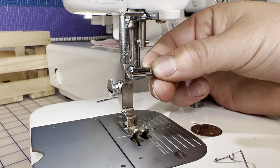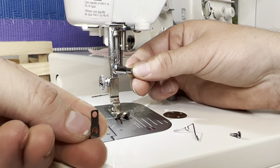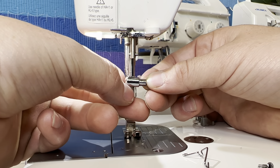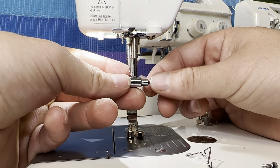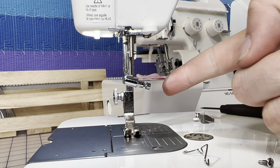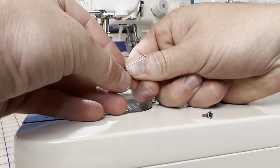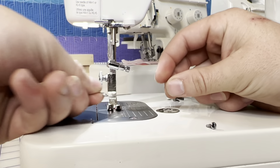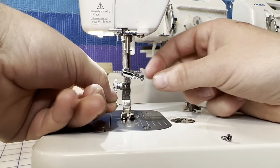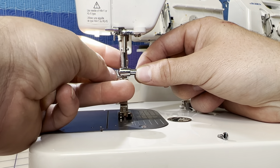When I pull down, it doesn't go down. Then you're going to grab this washer piece with the two screw holes in it and put that facing to the right side of the machine like this — and that's pretty much it, just like that. Now you should be able to let go of everything and everything should stay on there. If you push this to the left it could all fall off, so I like to go ahead and put the thread guide back on at this point. Hook facing up, open side facing towards you and to the right.